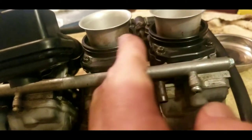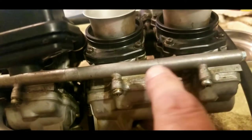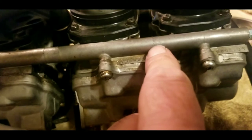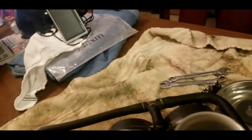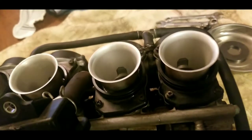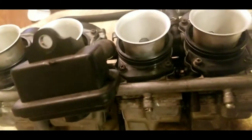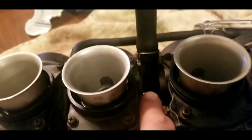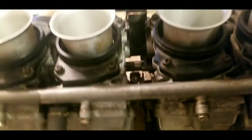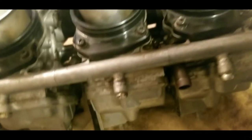In order to fix this o-ring you have to split the carburetors and replace it. There's a seam right here and a seam on the other side, and there's another o-ring up here for that T — I believe it's an EGR or air vent T, I'm not a hundred percent sure. Then there's this big one here between two and three on the breather, but the only one that was leaking was this one right here, although if it goes well I might replace the others on this side too.